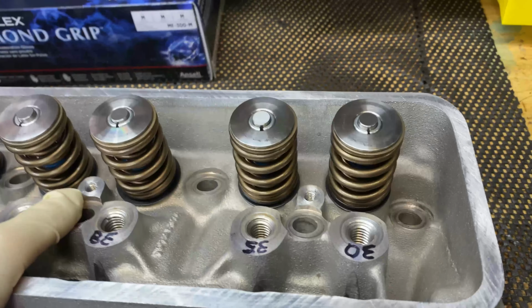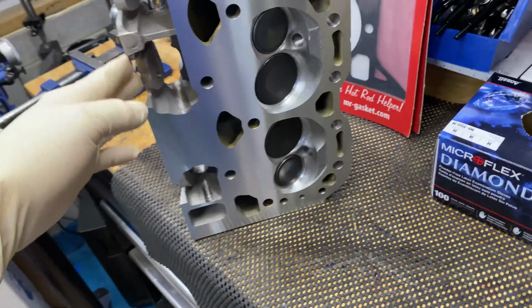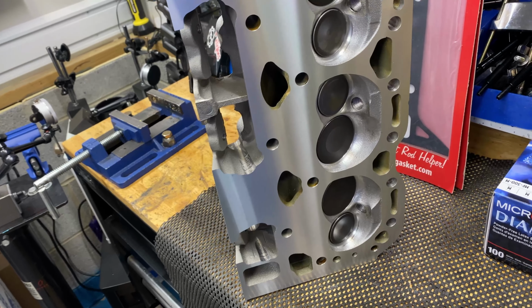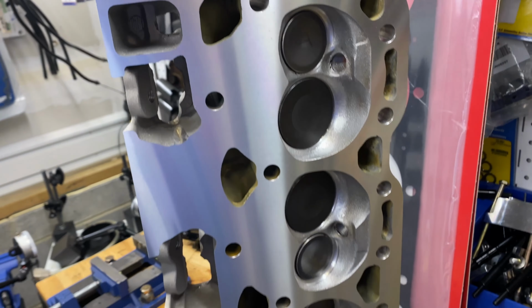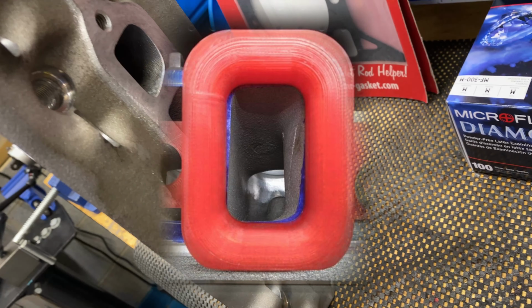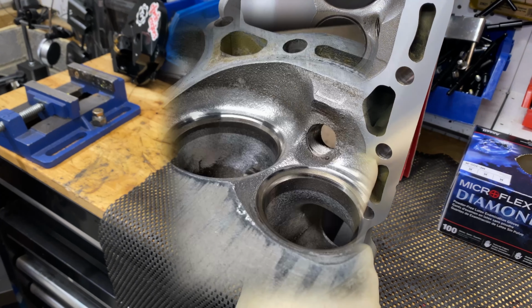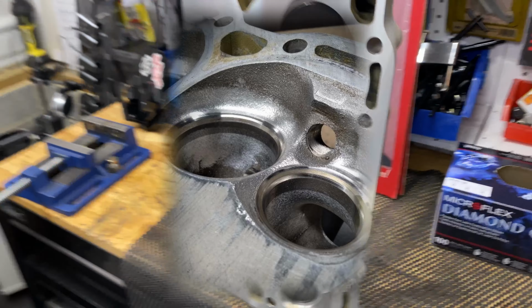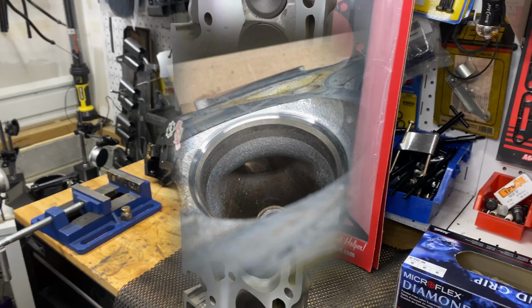And then the spring install, a careful spring height install. Those springs were provided by Ray, the owner of this engine. I think they were Tick Performance, something like that. Anyway, that's the heads, and I'm going to do a chamber, cylinder combustion chamber CC, just so I can know for the records, and we'll know exactly what the compression ratio is on this very mild 355 LT1.